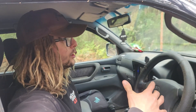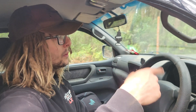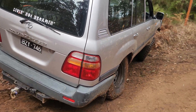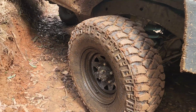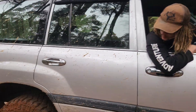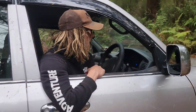I'm going to do a quick demonstration to show you guys essentially what a rear diff lock does. We've got a small embankment here that I'm going to try to drive off. Theoretically being open diff, once my flex maxes out it shouldn't spin anymore, so you'll see only one wheel spin. And then with the rear diff lock on you'll see both wheels. So we'll flex up and see if we can get it to work. So that's with the diff lock not on - as you can see, one wheel spinning. Now we've got the rear diff lock engaged - remember before how it was single spinning, now when we accelerate both wheels are now spinning. That is essentially what a locker does.